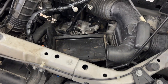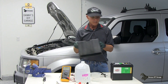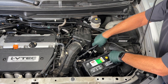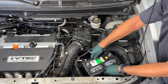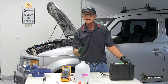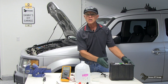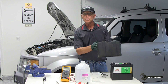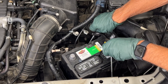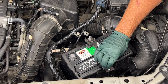Tip number five: make sure the battery tray is clean. Also, the plastic cover does have a purpose — it keeps the heat away from the battery. I see a lot of cars out there missing the plastic cover simply because the technician didn't want to take the extra two minutes to put it on. Make sure this battery cover goes back on. Also, the battery hold down doesn't need to be real tight; it just needs to be tight enough to hold the battery from moving around.